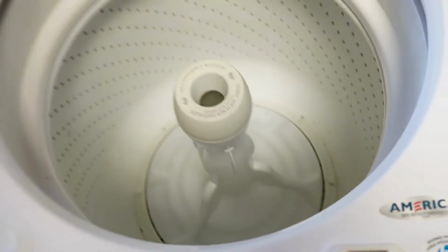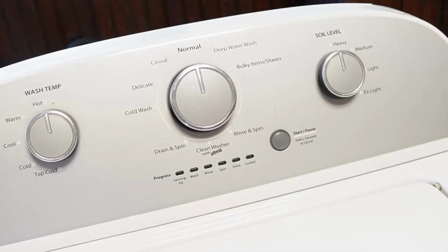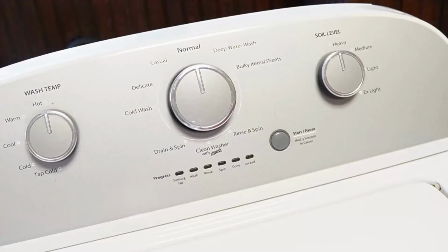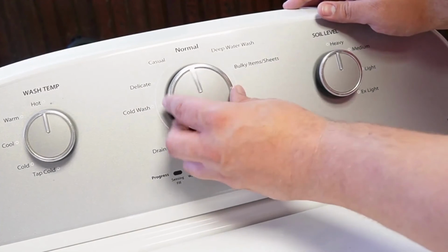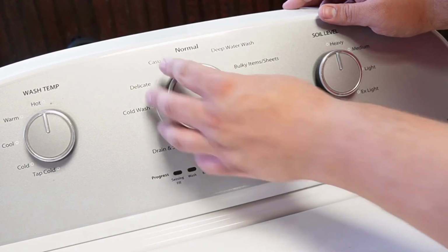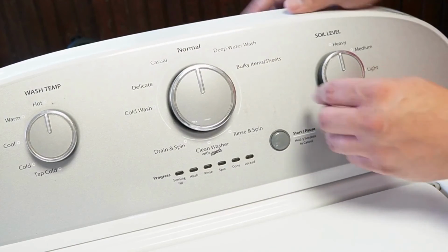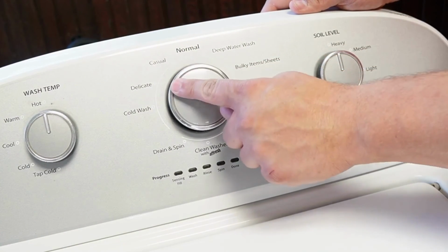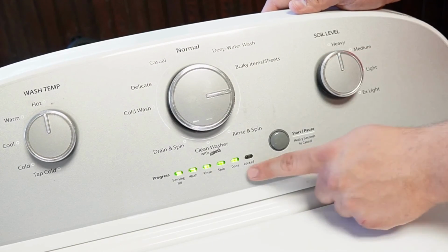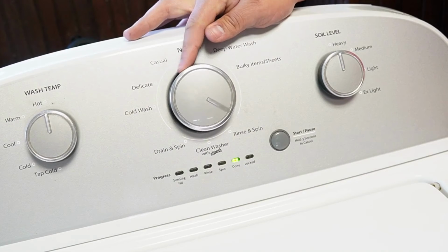Now that we've done the first reset, let's go ahead and attempt to recalibrate this washing machine through the calibration mode. This is a must-do if you've installed any new parts on the washing machine, from a board to a balancing rod. With the washing machine freshly rebooted, you want to rotate the dial again counterclockwise 360 degrees. Then you'll turn the knob right 3 clicks, left once, then right once again. It should be pointing at this point at 3 o'clock or all the way to the right position. You need to do all these things within 3 seconds, and it may take a few attempts, but if you've done this right, all the lights at the bottom of the washing machine control should flash on and off, showing that you've entered into the diagnostic mode.